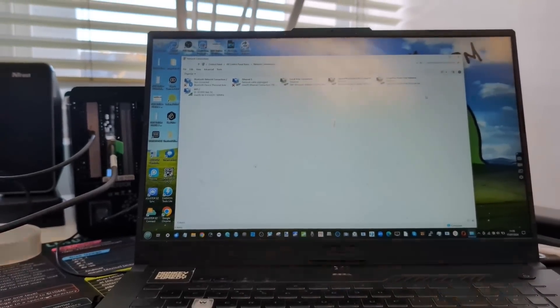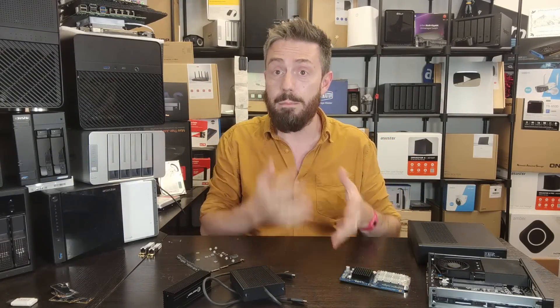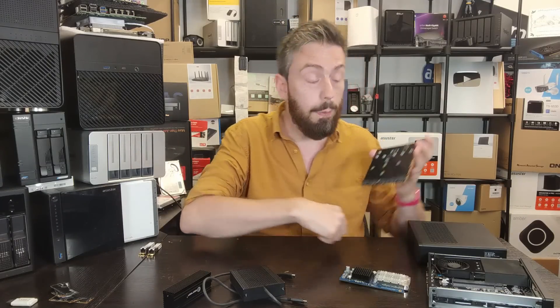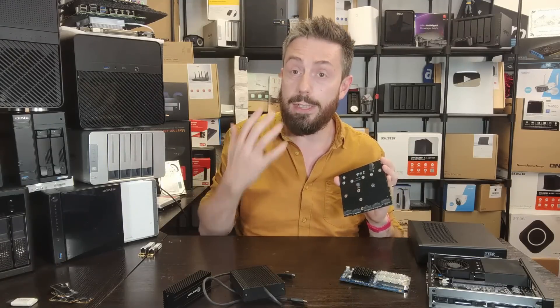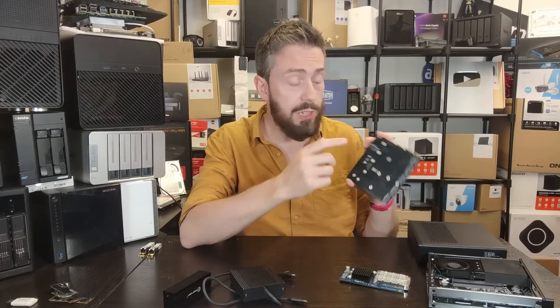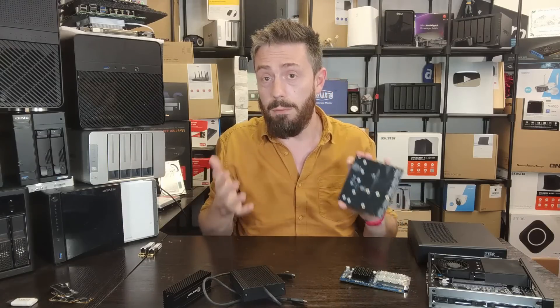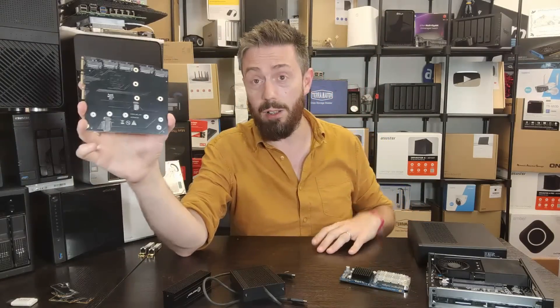The result was that every time we introduced the 40G card via the PCIe external adapter, it kept crashing the test machine with a Blue Screen of Death. We're now reconfiguring and opening up another test machine for further testing. We've already set up UnRAID with a ZFS pool, created the share, and done all the setup — we're ready to test individual drive and RAID performance over 40GbE. That's where this video ends for now. As mentioned, this isn't a review — we are assessing and evaluating this prototype card.